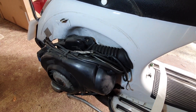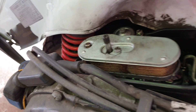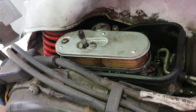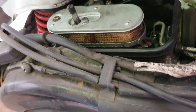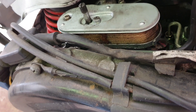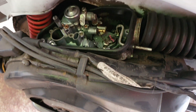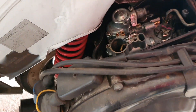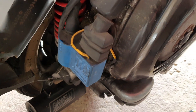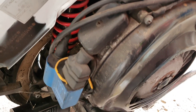The first step is to remove the cover over the carb and air cleaner. I'll remove the cover, move the fuel line, take the screw out, and disconnect anything else running to that — including the throttle cables, choke cables, and things like that — because I'm not going to need them anymore. I've now disconnected the cables, air intake tube, oil injection tube, and taken the air cleaner off. Next I'm going to tackle disconnecting the wiring, which involves taking the screw out and disconnecting everything.